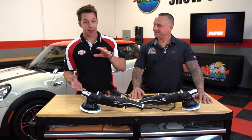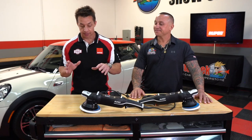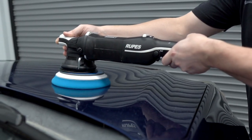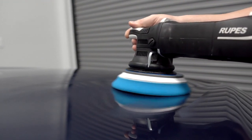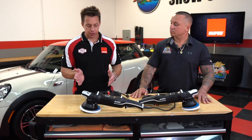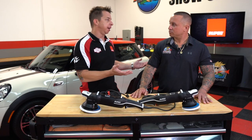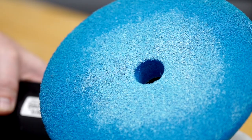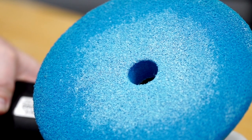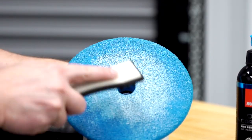When you're polishing paint, you are building up an incredible amount of residue into the pad. The microfiber pad is the worst because it holds onto the residue. If you were polishing a single-stage red car, your pad would turn red — you'd see a significant amount of spent paint. The problem is clear coat makes your pad turn clear, so you don't see the residue, and people tend to avoid cleaning the pad.